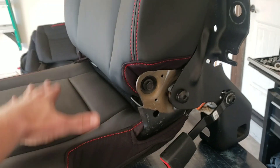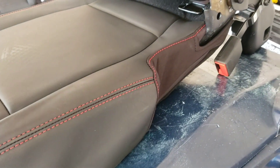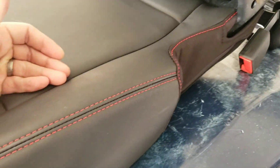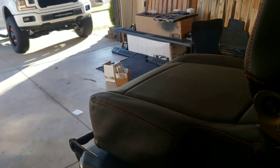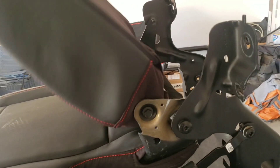Next is the headrest. I'm not sure where I'm going to edit this in, but this is the rear seat. This is the single rear seat — of course the process is the same throughout the whole thing. You've got to carefully remove it so you don't break the J-clips. You put the J-clips back in. The rear seat is completely different than the front frame-wise. Once you take it out, the back moves freely and it's two separate pieces: the bottom and then the backing itself.